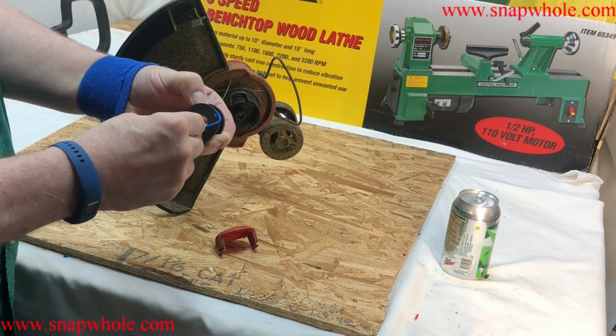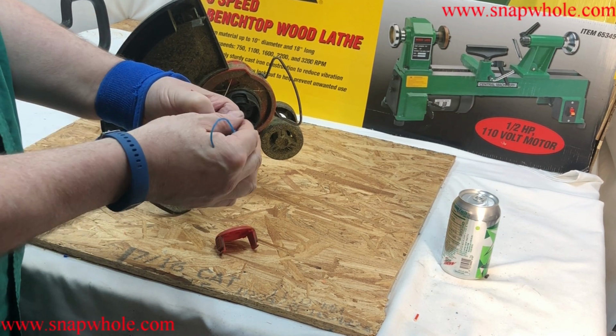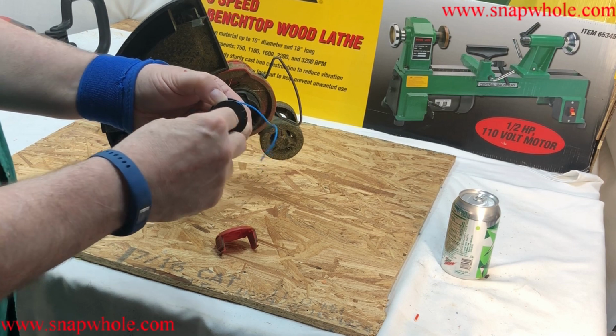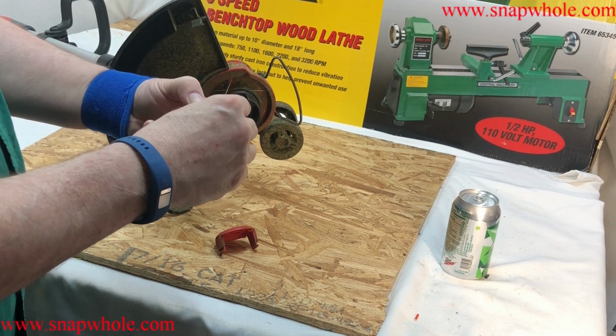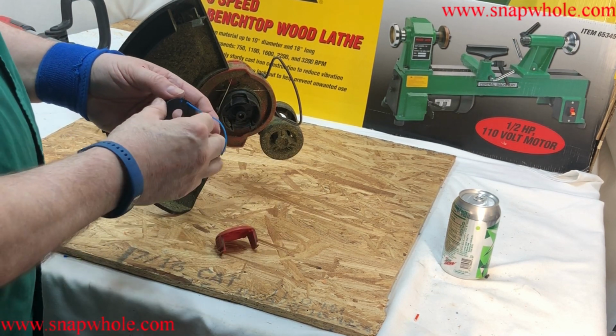They give you these little holes, and if you don't keep that tied down when it's outside the trimmer, it'll lose tension. All of these layers will unspool, and when you just pull this to get it tight again, it doesn't go back uniformly like it was. It goes in out of order, and that's what makes these things feed wrong. They get stuck and you have to pull the line.